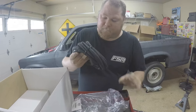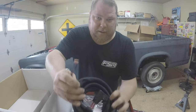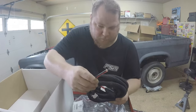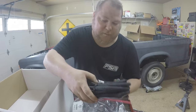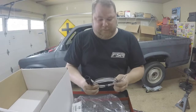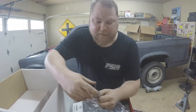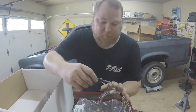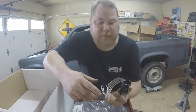This is probably what I'm going to put on first - the main power harness. There's your red and black wires and I'm going to run these directly to the battery in the back of the truck, because that's what they recommend. They say don't go to the starter and don't go to the frame for the ground. The output/input cable lets you send signals from the Holley Terminator EFI system - for example, I'm going to send a trigger to ground my electric fan relay and turn my electric fan on at certain times.